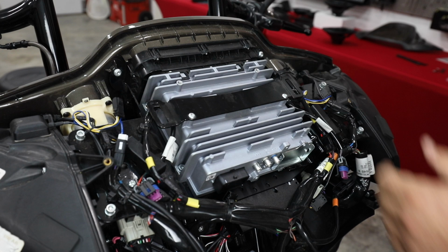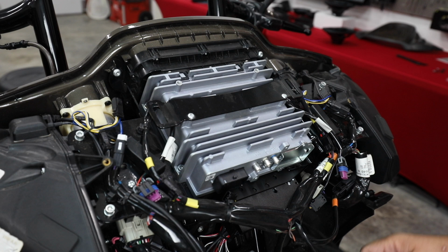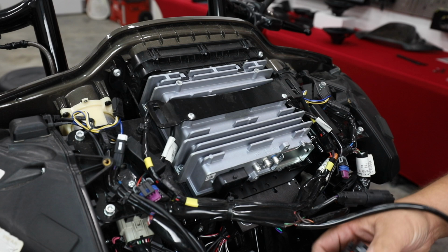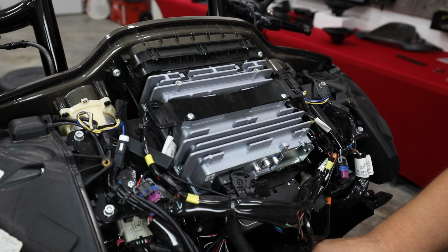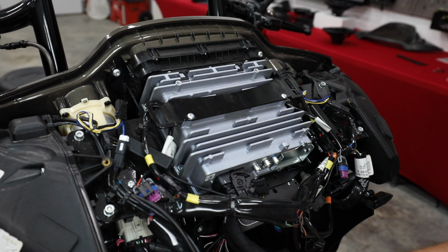So our radio is back mounted in. So let's look at our harness again. So this is our new radio harness. We're going to take the end that left the amp. We're going to plug it in, just like the factory connector was. Spin this over. And then we're going to take our original connector and plug in the other side of our T-harness. So this is very, very simple. And just like that, you have wired your amp in to your radio.